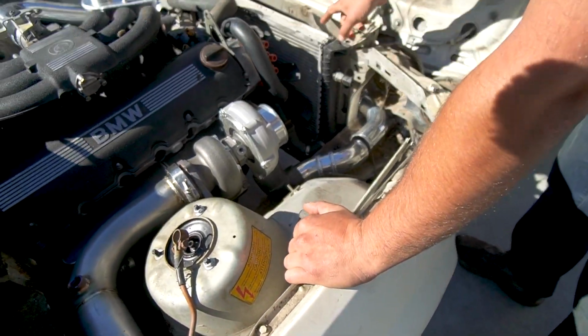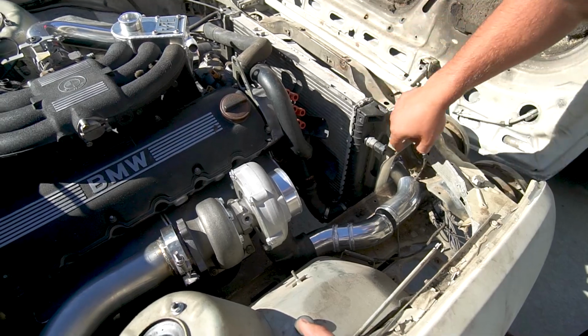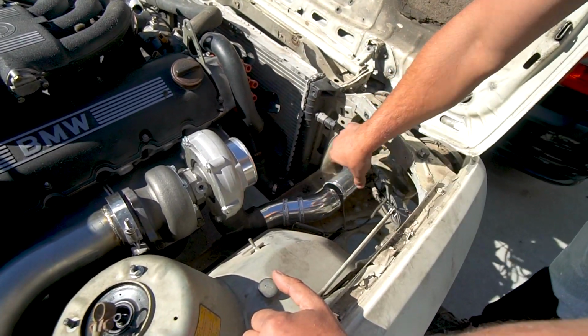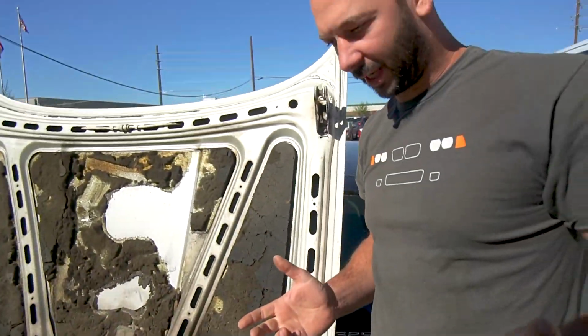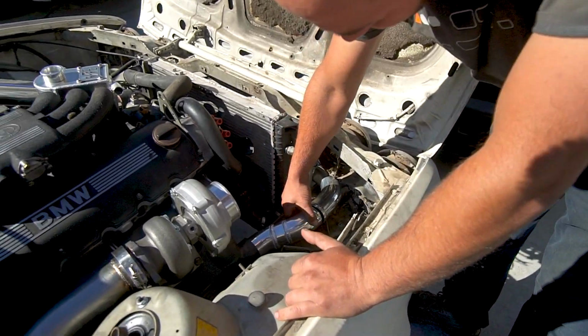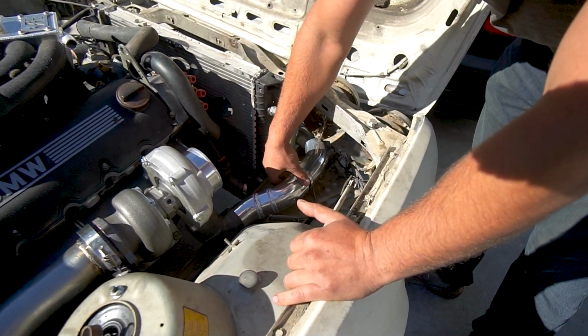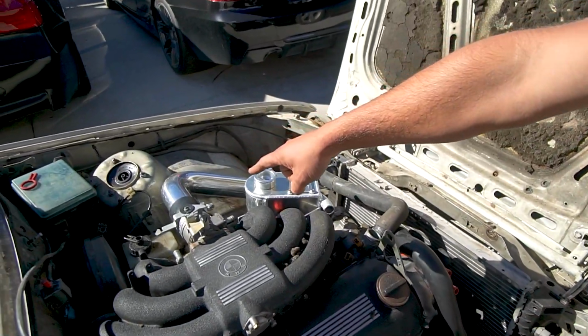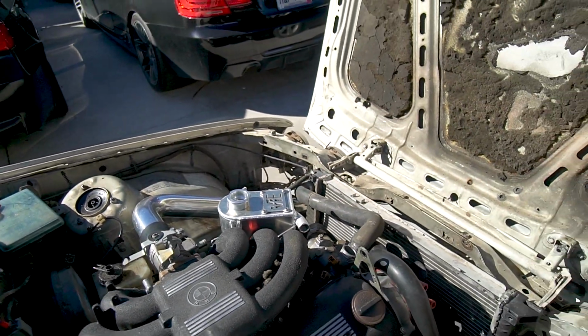And then we mid-mounted the intercooler. So it's right there. It's not a bottom mount, it doesn't go way down there. So it's a shorter run. Might help spool time slightly, we'll see. I need to get couplers. These are all just his test couplers. So we get a tight radius 90, a straight, and a straight. These need to be a little bit longer.